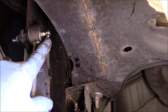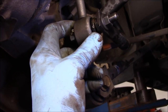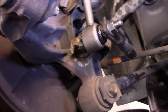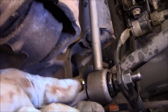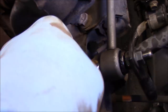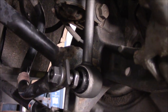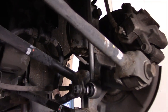Now you see the grease fittings — that one is facing down so we can get in there real easy with the grease gun, but this one is facing up and will be a little more difficult to reach. So we're going to turn that grease fitting now. That's where this 3/8 wrench comes in handy. We'll point it down so we can get grease into it. Next we're going to come over to this side and tighten those up, and that's it — we'll be done.